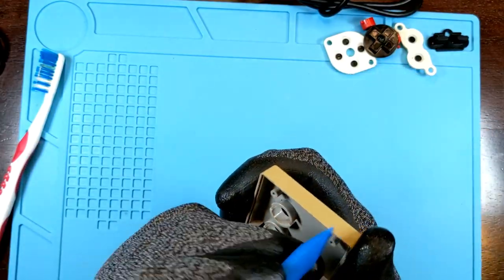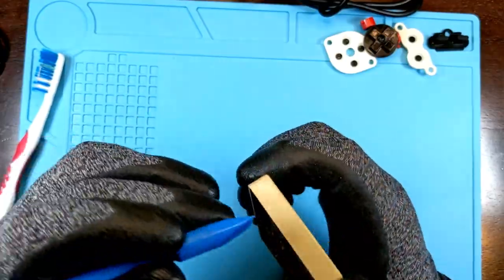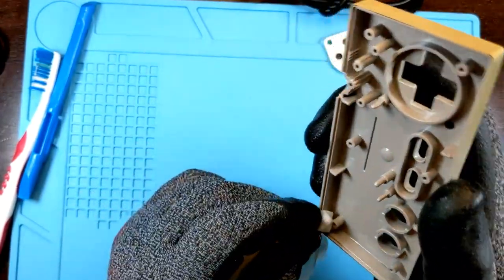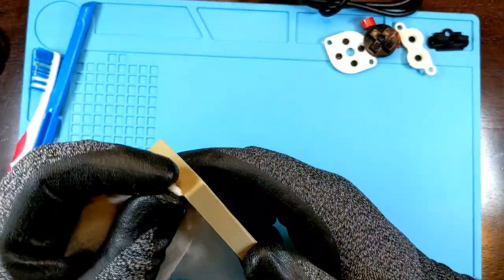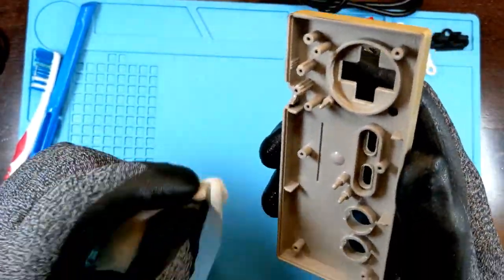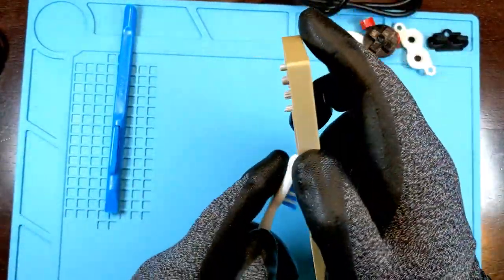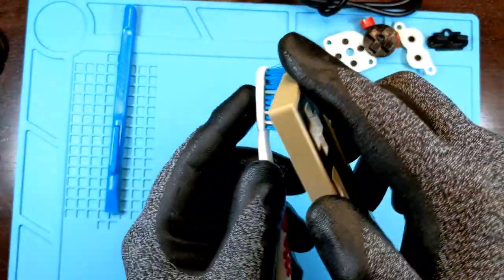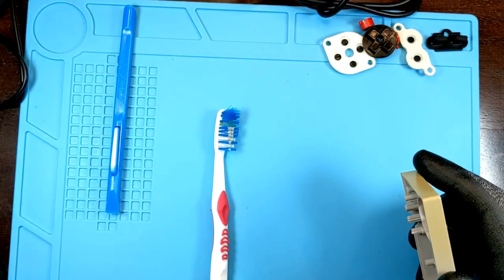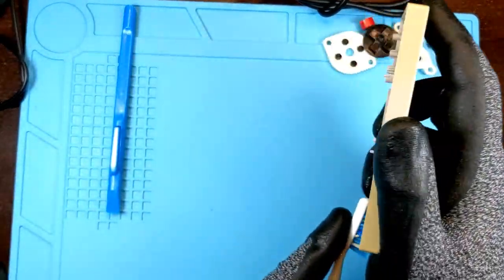And you don't necessarily want to clean off everything. You just want to work everything up so that you can come back in and wipe everything off, okay? So go in here, wipe all your edges. My table is noisy today. Wipe off all your edges, go back to the toothbrush and brush it out. And then I'm going to flip it over as I brush it and brush upside down, because that's going to allow all the material to fall down onto the actual surface. Pretty clever. Let's brush all that.